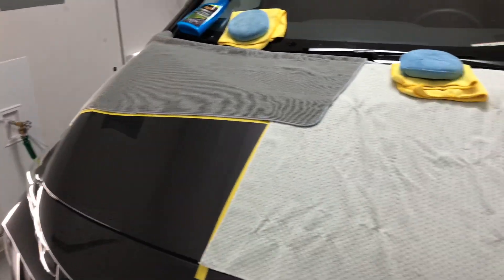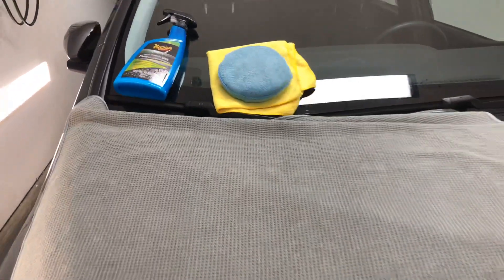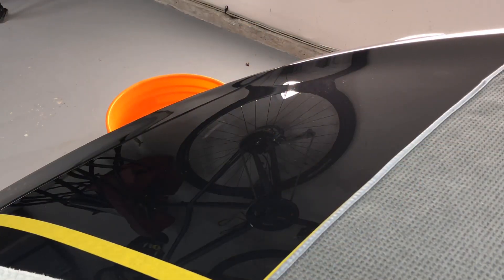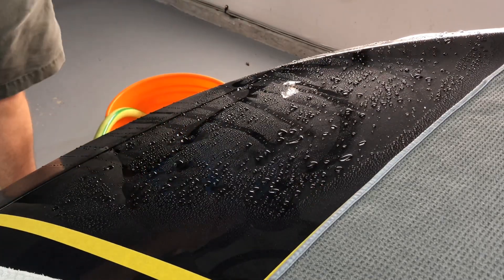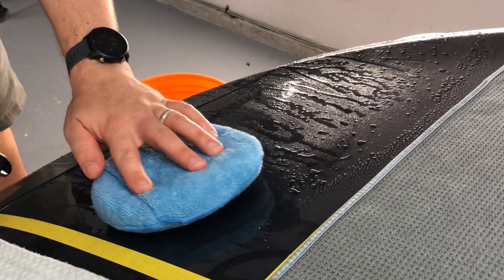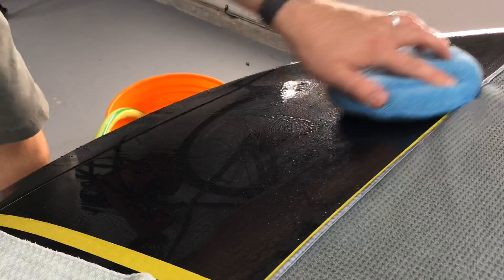Like you see here — where you wet it, spread it, and buff it off. Much easier. Still uses very little product. Potentially even less, because you've got the water to help carry it around. And overall I think you're wasting more time, effort, and cloths, and potentially running into application, removal, and residue issues doing it the dry way — even though when done appropriately with way too much care and attention it does work well.